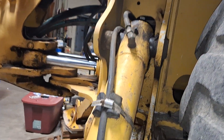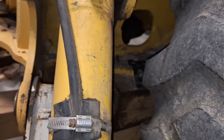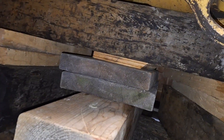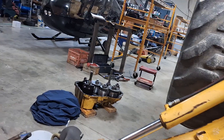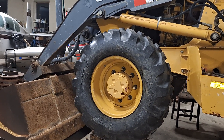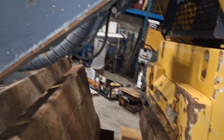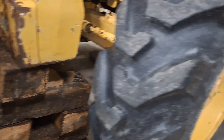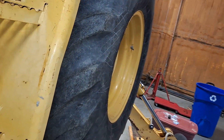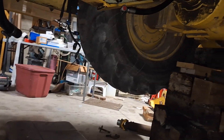Down in there I bolted these pieces of wood on — first I put a screw in with a plate to hold that top beam so that when I was jacking and trying to put the blocks in, I wouldn't have to reach up in there to get that one in last. It's pretty stable up here. It's only got 3,500 hours on it. I lifted the front end up first, then lifted the back end until it was level to get the blocks in.